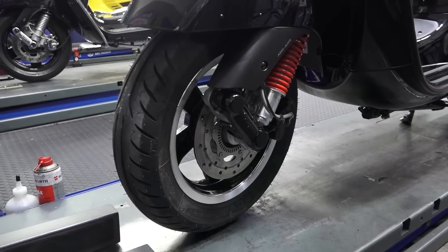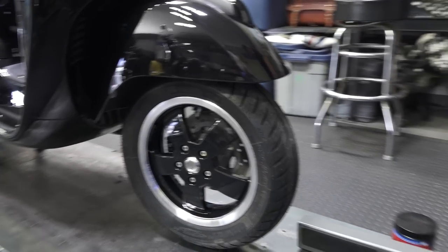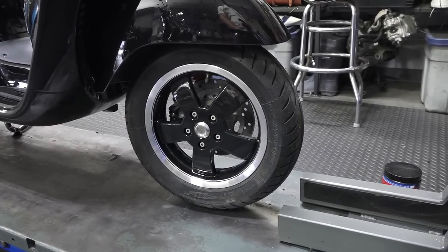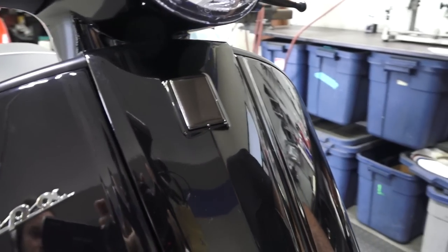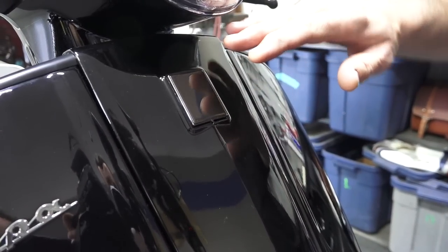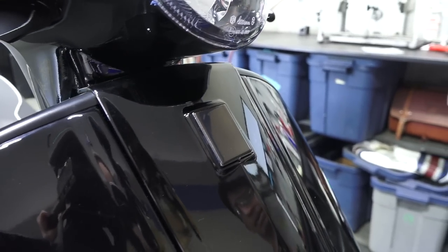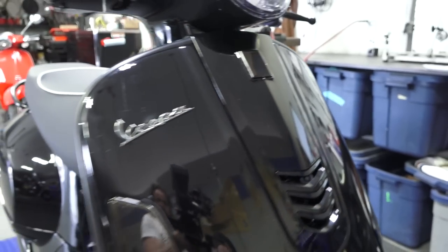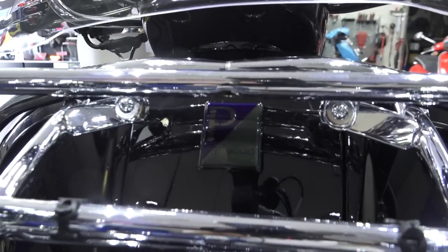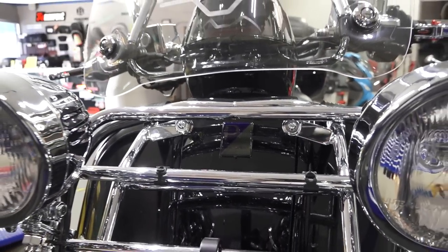The stock rims have a five-spoke classic design — nothing spectacular, but they've dressed them up with a two-tone finish and a spun aluminum edge, which is factory on a GTS. The last custom touch is the blacked-out badge. What we did is wipe the paint finish off the original badge with acetone, then shot a clear coat with a black pigment in it — it gives a kind of mirrored finish. We have that badge available on our website ScooterWest.com.